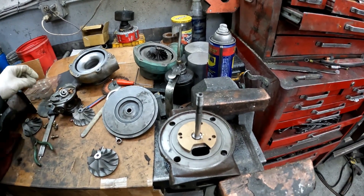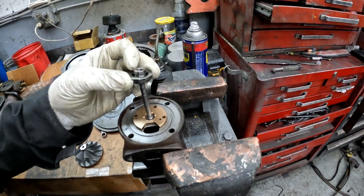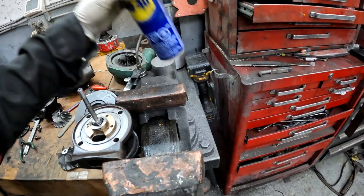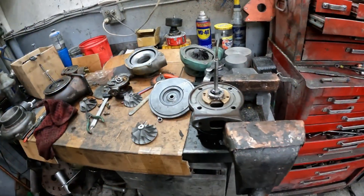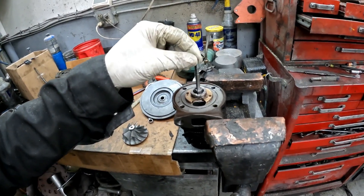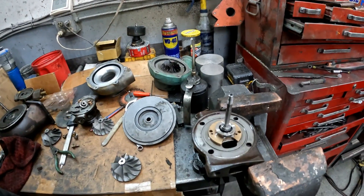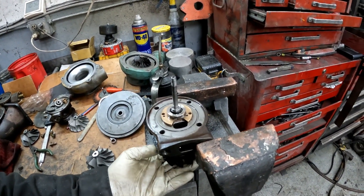And that's the new 360-degree thrust washer that I got. I'll just give that a clean — that's a bit of engine oil. So there are the new bearings and thrust washer in it. There's a little bit of play but nothing abnormal — it's totally normal. So I'm just going to put her back together and send it.